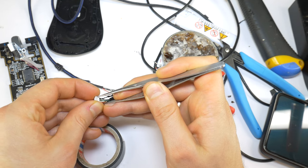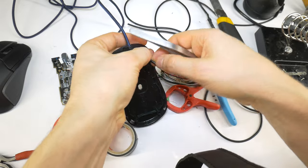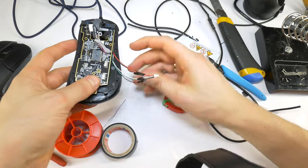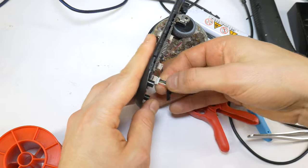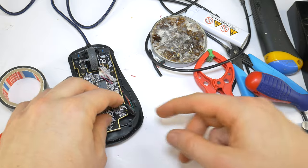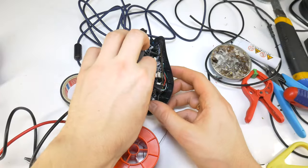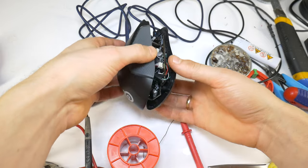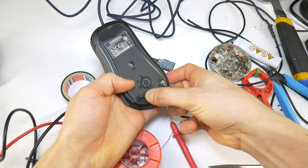See how it works for you. Last check — it looks like it did at the start. Put the cable in the place it is supposed to be, put the main board back and screw it in. Plug in the new USB cable into the main board and carefully place the wires so that they do not interfere with anything. More insulation tape can be used if needed. Add back the top housing part — the mouse can be put back together. Screw the mouse back together, glue back the feet, and the hard work is done.